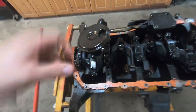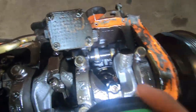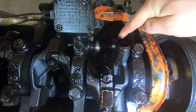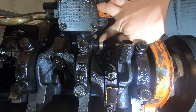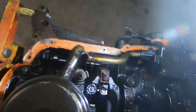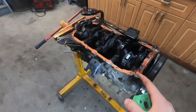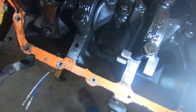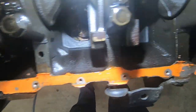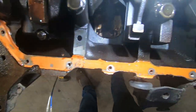There's nothing in the oil pump pickup. The camshaft looks barely used apart from the obvious — obviously a spot where the rollers have been riding, but there's no huge wear, no flat spots on it. So that was doing alright. I want to say where I think all the gray was coming from in the oil was just wear from the cylinder walls, because if you look on the edge of the block you just see gray streaks. I don't think it was coolant related.